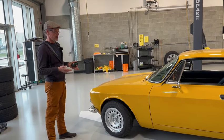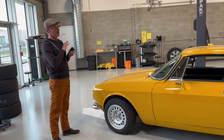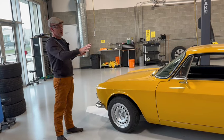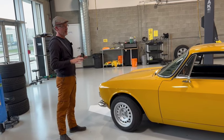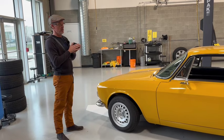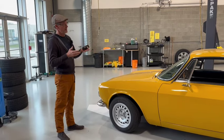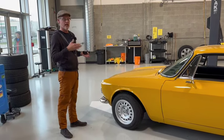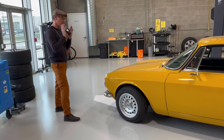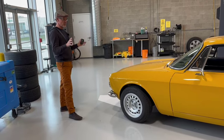which is excellent. And, you know, when you try to get an old car and you want a perfectly glass smooth panel, you generally have to put in quite a bit of filler and primer and then block sand it to get that kind of perfect paint finish you're looking for. And so with that, you get quite a bit of variation, relatively, in the depth of the paint. And that's why we see some paint depths of 300 and others of 1800. But the end product of that is that when you look at the car and you look down the sides of it, you have perfectly glass smooth panels. Okay?